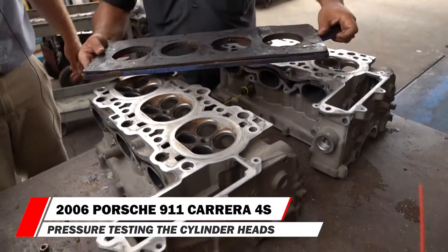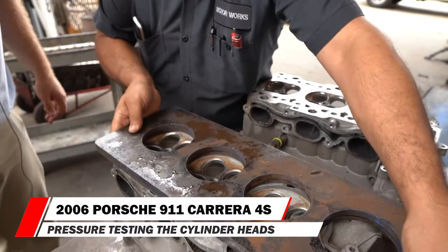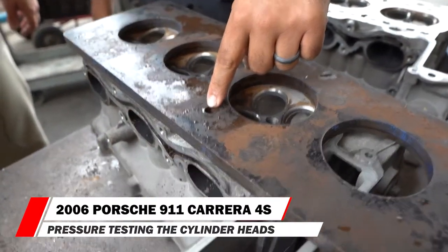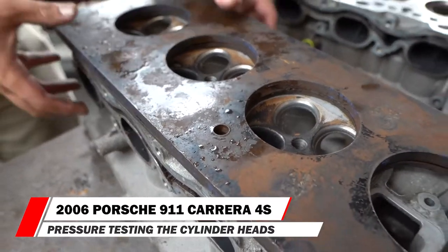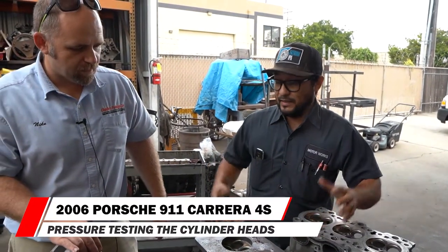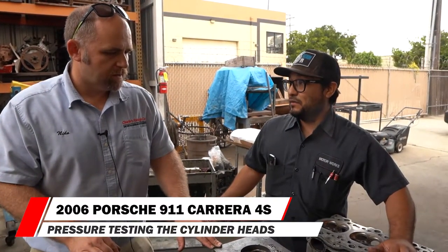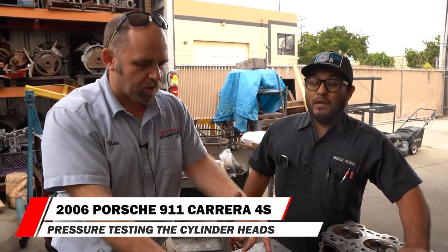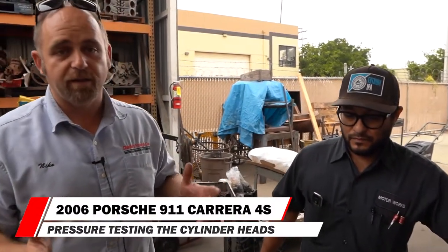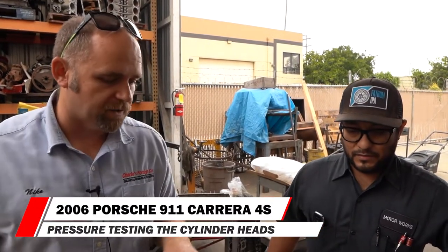This is the actual plate that we use — that's the rubber side, it gets set like that, and then we pump the air through this hole. It gets clamped on the machine. It's very simple, very basic, but it's very effective. They dunk this whole thing in the water and you're just looking for bubbles — air escaping. If air is escaping, then there is a coolant jacket problem somewhere in the cylinder head.